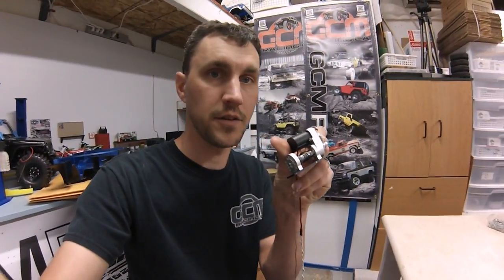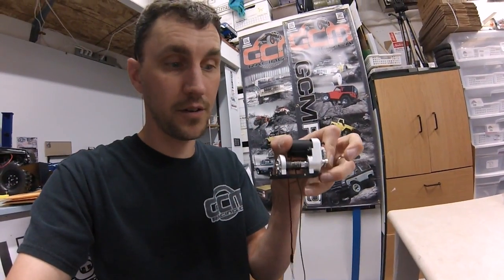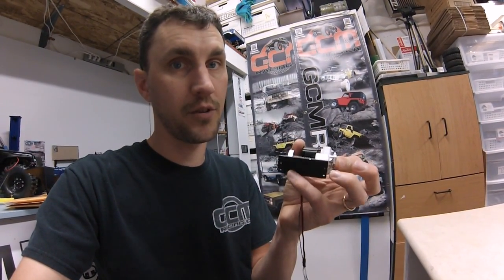I'm going to give you my review of this SSD aux winch - I pulled some pretty serious weight with it, so stay tuned for the whole video footage on that. Before I even start, I want to note that after I was done testing, I realized that the four screws on the bottom that hold the base plate onto the other parts of the winch - you better take those out and put Loctite in them, because after trying to tear this off the roof I realized I had loosened them pretty severely.